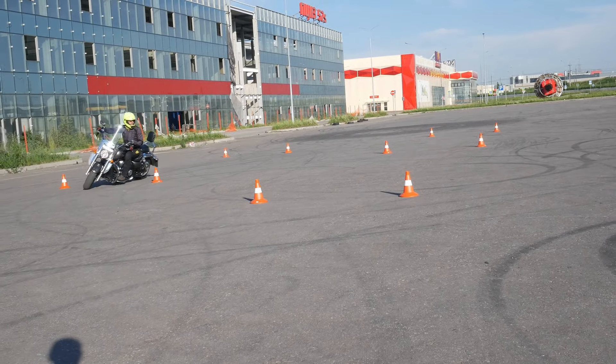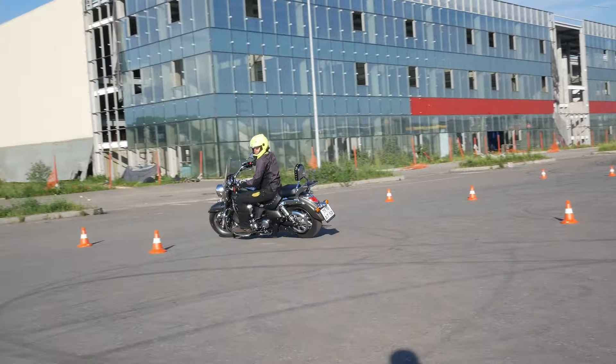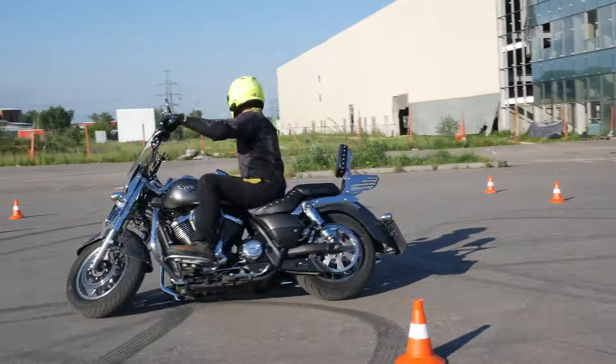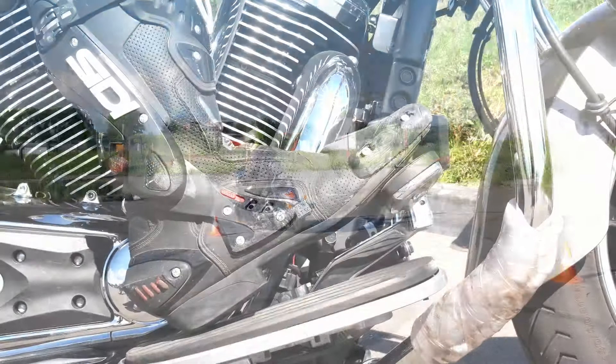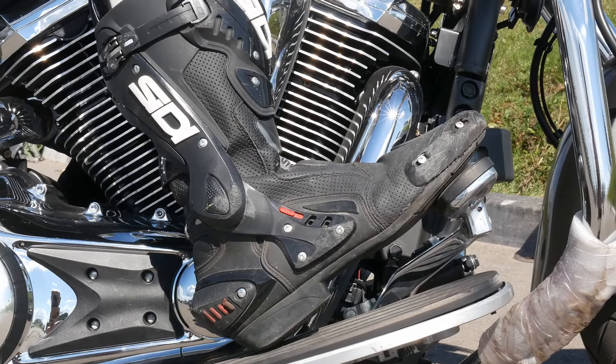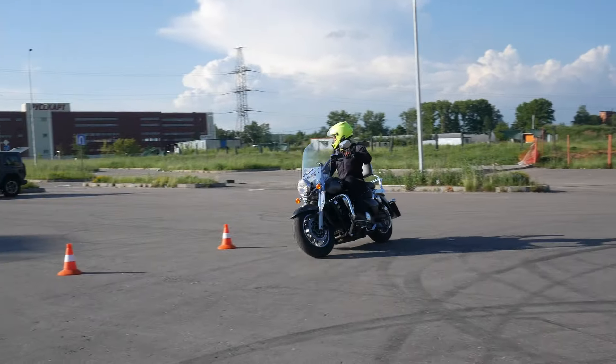The second common cause of burned clutches is purely a rider's mistake. When learning to operate a clutch and ride in the friction zone, students often tend to apply too much rear brake. When you apply a lot of brake, you can notice that you have to release the clutch much further to make the bike move.